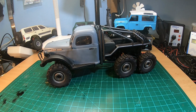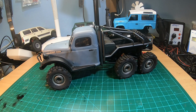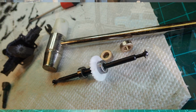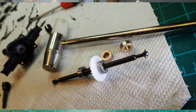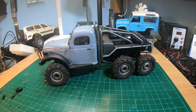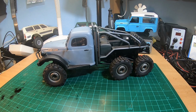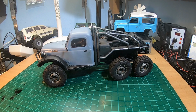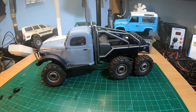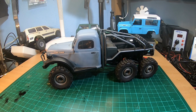They sit firmly. Only one pin was quite loose, and there I used strong permanent Loctite and hammered them in, and no problems. But I do not really know if it's really necessary to change the bushings to bearings, the more so if you want to drive your Atlas in water, because ball bearings can rust. Bushings do not have big problems with this. However, I did it, and of course I lubricated all the gears too.